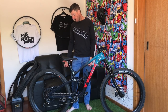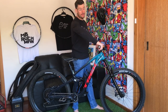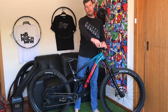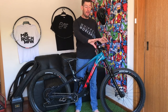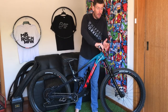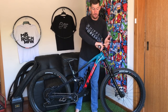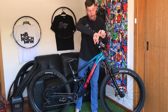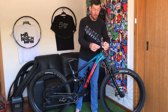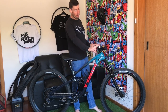It comes with 820 bars, which I cut down to 750 plus grip width, so I'm at 760 functional width. I took the Bontrager grips off because they've got metal clamps on both the outside and inside. I don't like the idea of a metal clamp on the outside — when you clip a tree, which is inevitable, you'll burst your finger open. I've got scars on both fingers from exactly that. Rubber on the end of the grip is much better, so I went with the ODI Elite Flow.